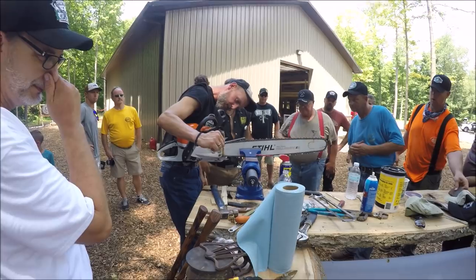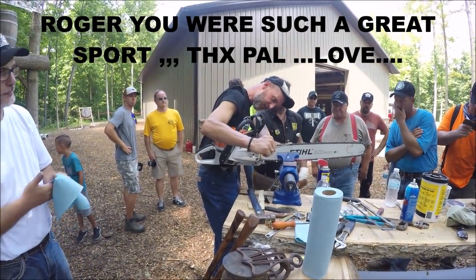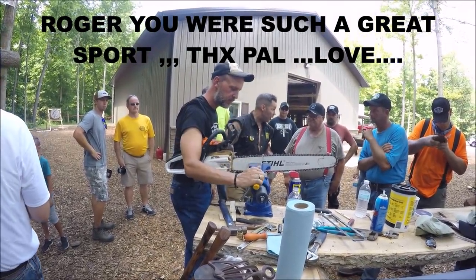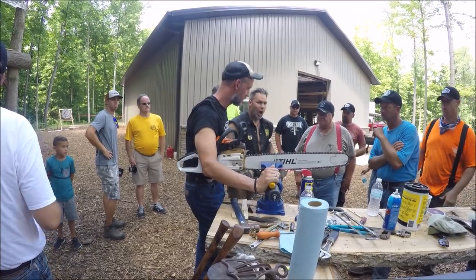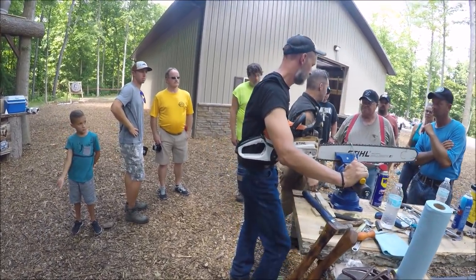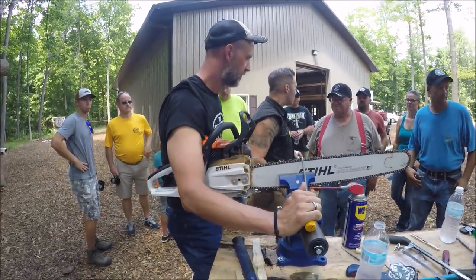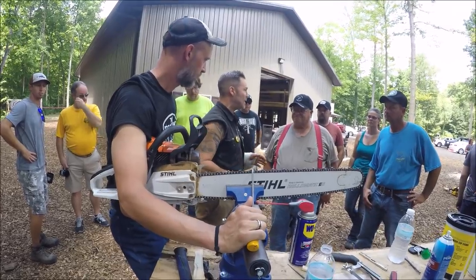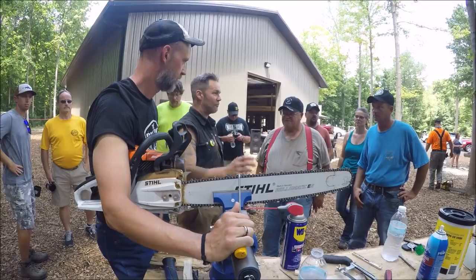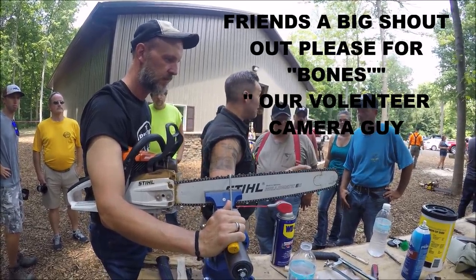What's your plan? That one there? No, that one's there. So you filed that, and probably what it was is it didn't get beat. That's what I was going to say a minute ago. When you're cutting and you rock a chain, you don't rock every single tooth the exact same amount. You could whack one side of the chain real bad, and you could hit the other side maybe not so bad. So how are we to keep these teeth the same size? It can't happen. It's a waste of time in my mind. That's what these rakers are for.